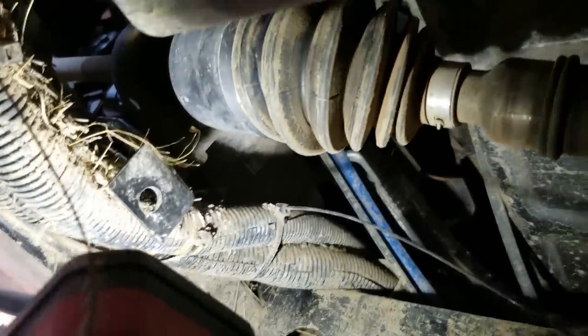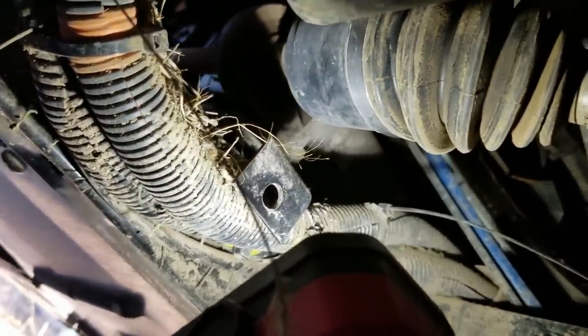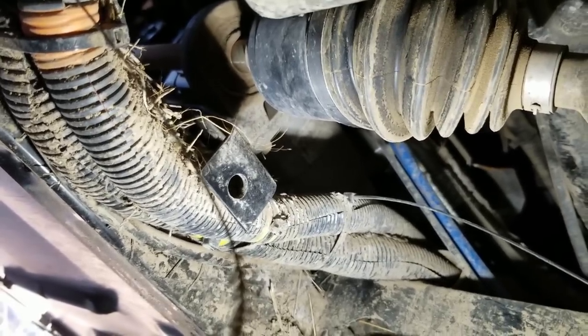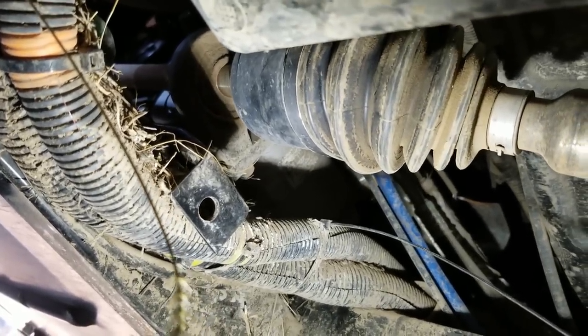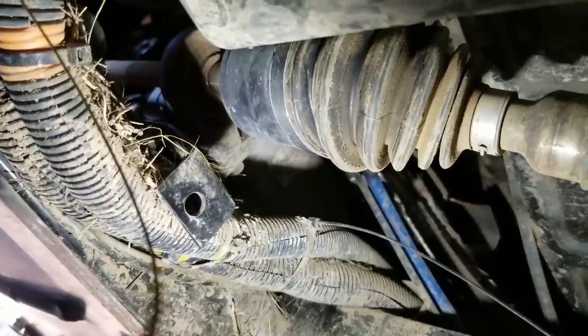Let's revisit the scene of the crime, Thelma. Look at that steady bearing - look real close. Behind the shadow, that shaft is real shiny while everything else is rusty. It probably pulled through there. There might be a shaft collar somewhere that's supposed to be holding that in position axially, and it didn't do its job.